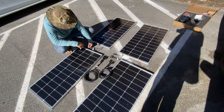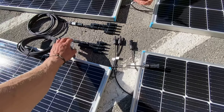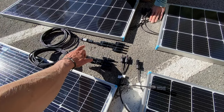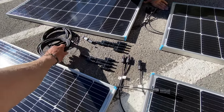Andrew came up with a good idea to map things out before we get on the roof. We're going to have a negative tree of all the negative wires coming in here, and then a positive tree with all the positive wires coming in here. We'll put the fuse at the end, and then have these wires going through into the rig.